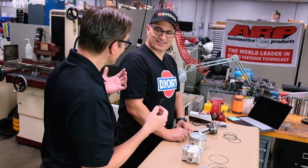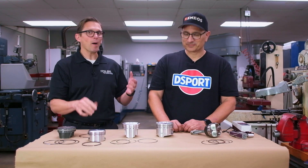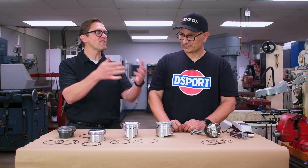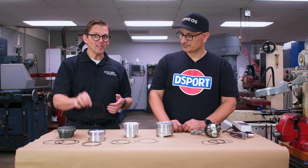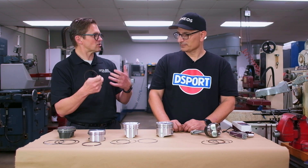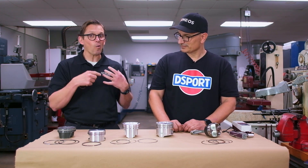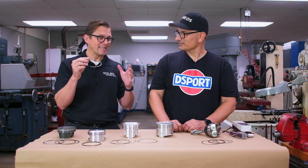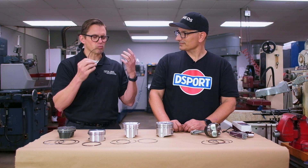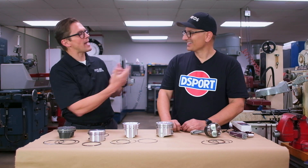What's causing all that friction is moving the oil. That's why we've gone to lower and lower oil viscosities over the years, because this ring isn't running in air — it's running through oil. And all viscosity is, is a fancy word for resistance to flow. So as a tribologist — friction, wear, lubrication — and as an oil guy and piston ring guy, all I do is rob power from the engine. I'm just trying to be less of a robber, take less out of your pocket, so you have more power getting to the crankshaft.